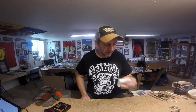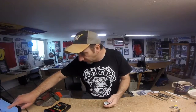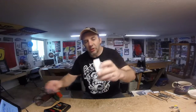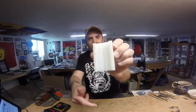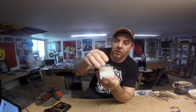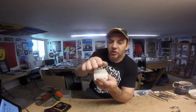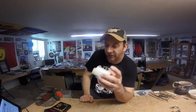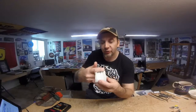Something else you should have if you can afford it is a tech block. A friend had this plastic one made. RTHO makes a really nice one, and some have two grooves — a tech block side and a leveling pad side, like a race car setup pad, so you can set your car on it and make sure it's really flat and level, checking if the body has any tilt or a wheel is off the ground, or if the chassis has been tweaked.